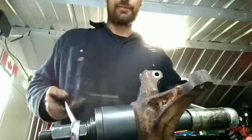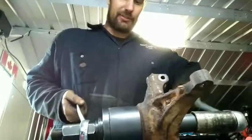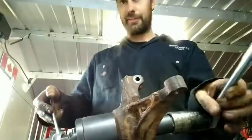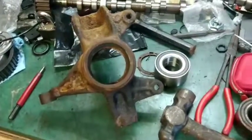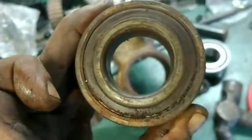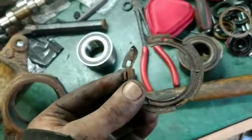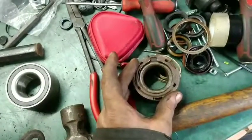This is the idea once it's off — you can do this on the car but I've chosen to take it off. Now that I've got it apart and the old bearing out, that bit stayed on the hub earlier and we got that off. Now we've got this bit out by pressing it out. This doesn't look as messed up as I thought it would — I think it's just got play in it and it's worn. But I think it was mainly the cage, which is here, that holds the ABS speed sensor at a set distance with the correct air gap. Well, that wasn't going to be right with this being all broken.